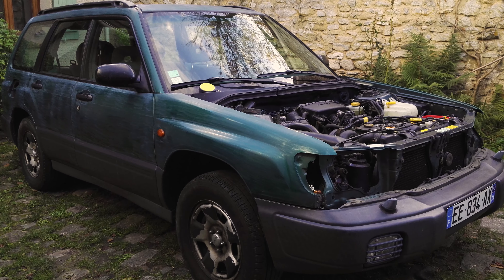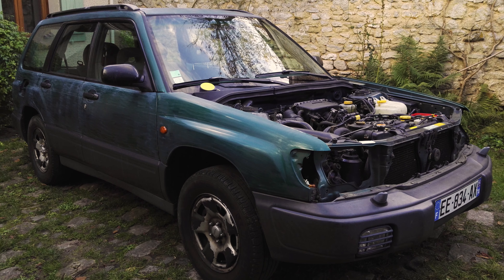After that I removed a few parts — actually not a lot. I removed the hood, front grille, headlights, some plastic trim of the openings, the logos on the boot, and the fuel tank trap door. And then came a very long process: masking everything you don't want to paint.